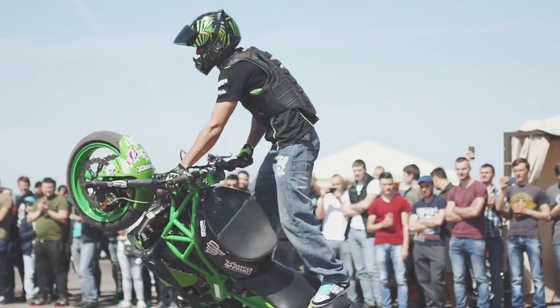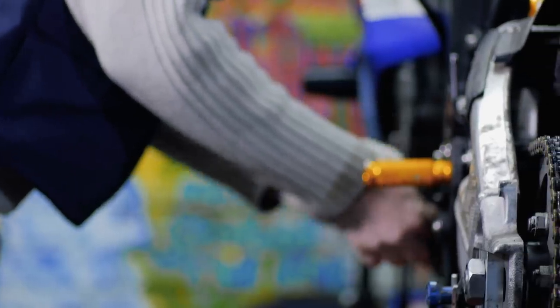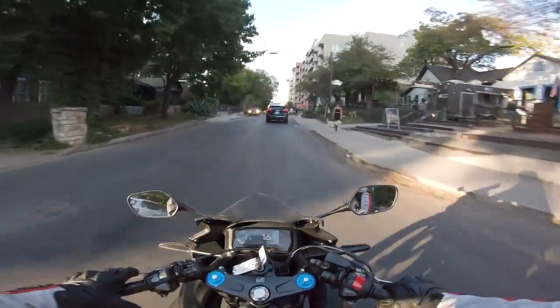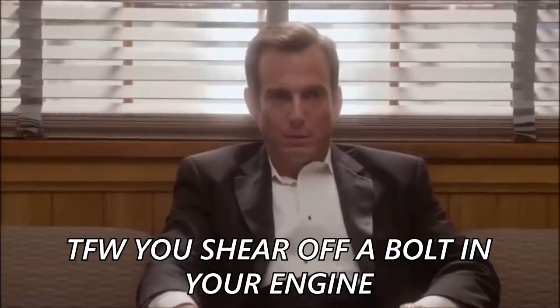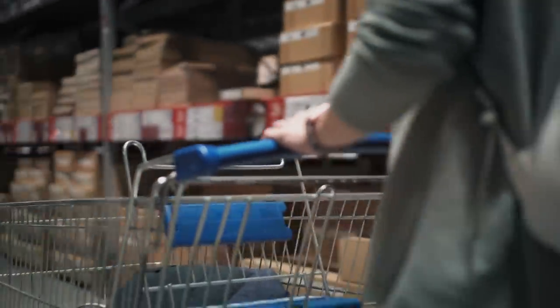Number three: torque. Torque makes your bike do all sorts of fun things, but too much of a good thing can be bad — specifically when it comes to torquing down bolts. Your manual should include torque specs for most bolts you'll be pulling out on your bike. If you're not using enough torque, bolts will work themselves loose and sometimes fall completely off — if you don't torque your front axle nut, you better be good at wheelies. More commonly, people over-torque bolts leading to sheared, stripped bolts or cracked threads. This is most common with oil drain plugs — cross-threading and torquing just a bit too far rips the threads out completely. Take that extra second and check the torque values in the manual.